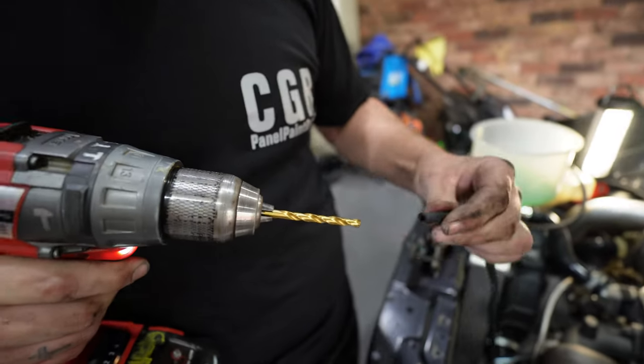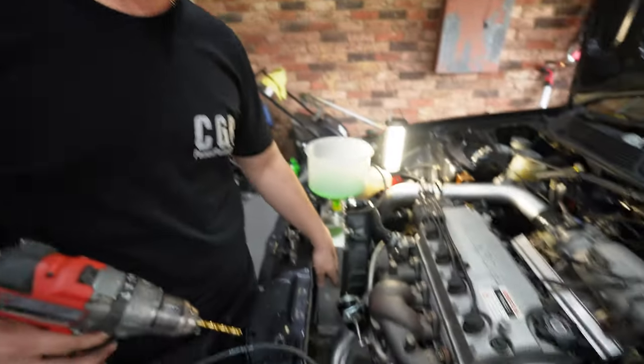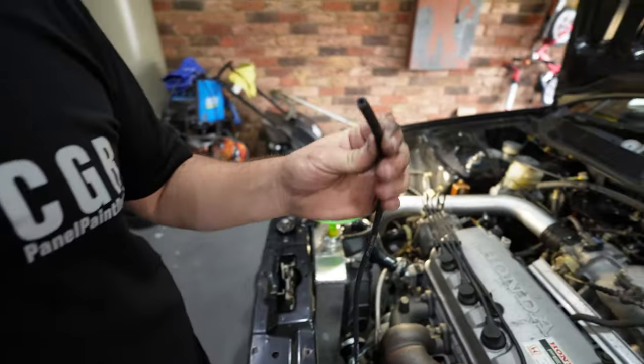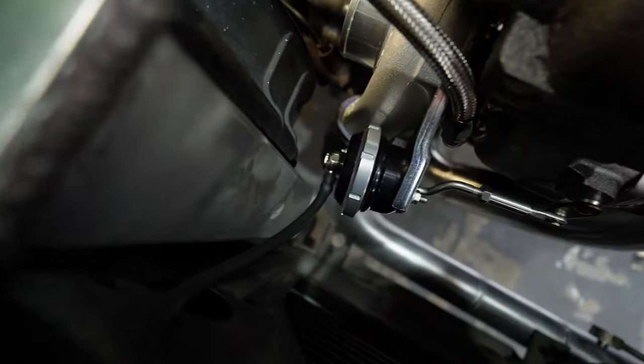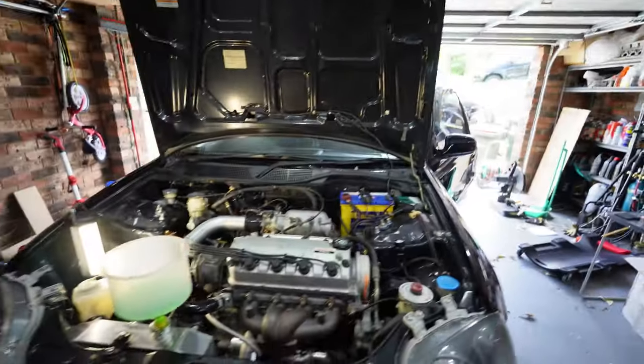Well, we don't really have much vacuum hose anywhere, and we've got quite a big vacuum fitting on this lovely Turbo Smart wastegate. So I'm just clearancing out the hose here to slip it on the barb. Send it. All right, I think we're ready. Hopefully we're ready. I think it'll be fine. Yeah, the coolant leak seems to have sorted itself out. So yeah, kind of my fault. I didn't scrape it off enough, but sorted now.